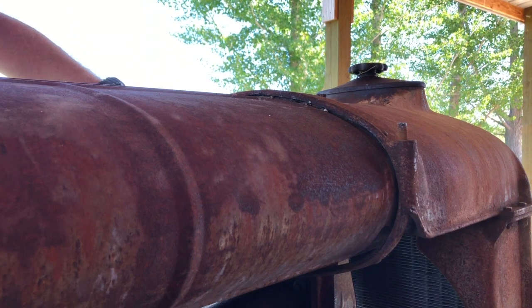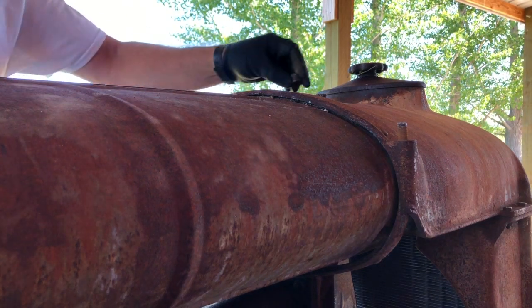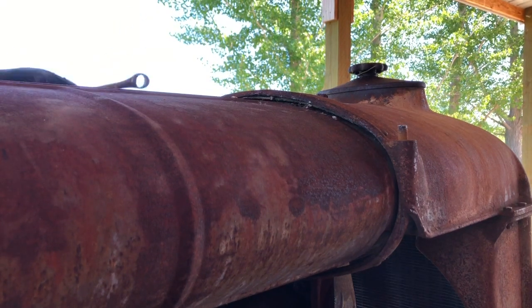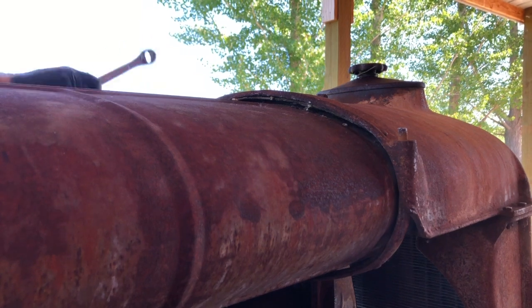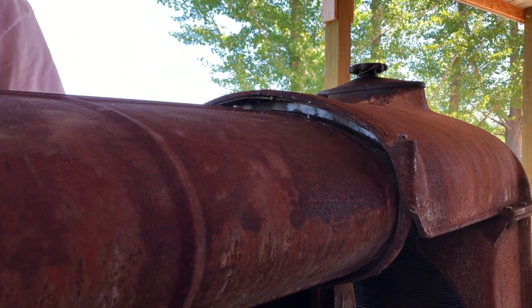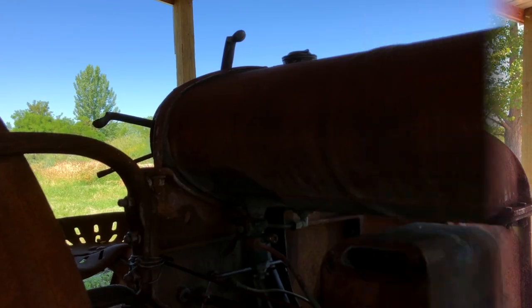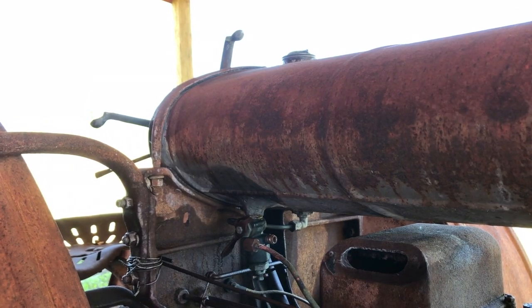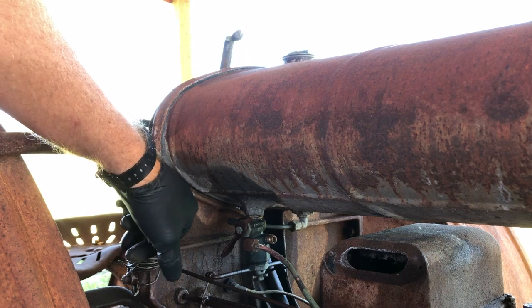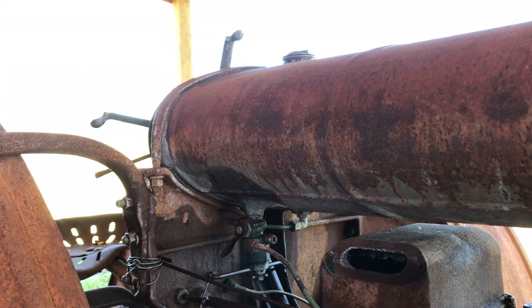It's been soaking for about two days with this PB Blaster stuff and no luck. So I think the remedy is to attack them from the top with that impact wrench. That side is starting to come off. Now we're talking about these nuts right here - you see this clamp comes down here, over the tank and through this bracket. Looks like just like the front, there's one nut on each side holding this clamp on. I bet this whole tank is going to come right off as soon as we get these clamps undone.